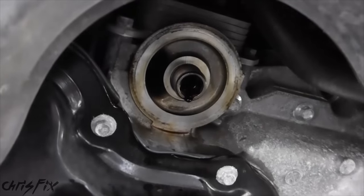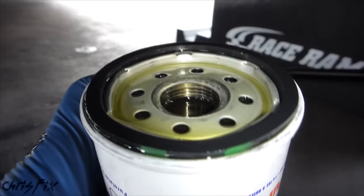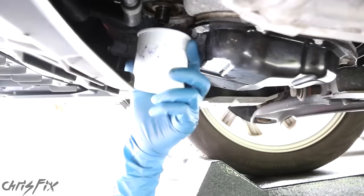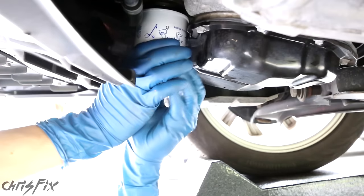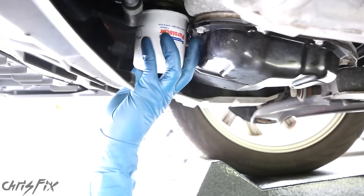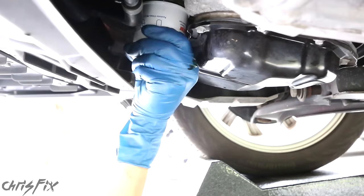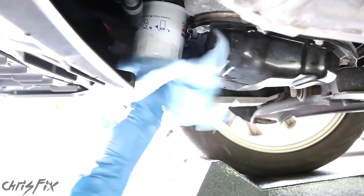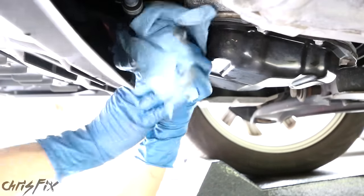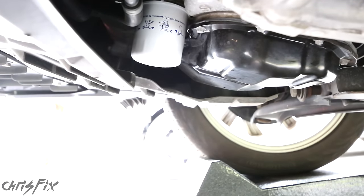Now you want to get oil around this gasket — just get a little bit of oil on a clean finger and put it right around the gasket. That's going to make it easier to come off next time, and it's also going to prevent leaks. Now let's install it. There's the drain pan, and if we look up, that's what the oil filter adapter looks like. The filter screws right onto that middle stud. Try to keep it flat as you turn so it grabs — you'll feel it when it grabs. Don't force it, it should go on really easily. Now just tighten it by hand — don't use any tools to tighten these. If your hands are slippery, grab a towel, clean off, and turn it more by hand. Step two, changing the oil filter, is done.